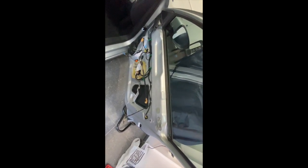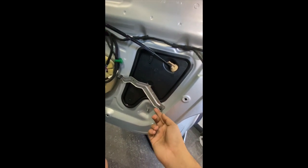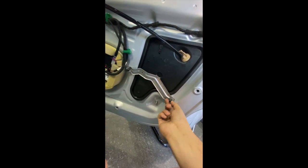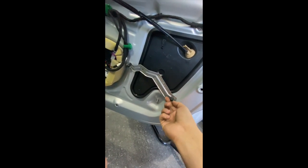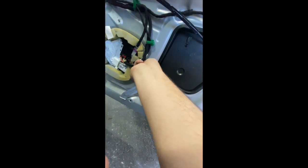The rest of your wires just need to be unclipped. So once you have the door pad removed, the next step to getting your door lock removed is you need to remove this bracket, which requires a T30 Torx. I've already loosened them for the purpose of this video — just remove them and your bracket comes out.